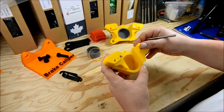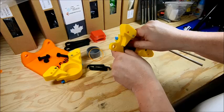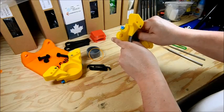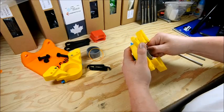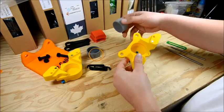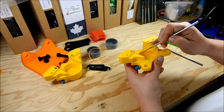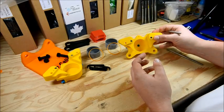And for that body, same with this side. Two fingers over here, two thumbs in the piston, slide it out. This one comes out a little sideways — pop it out. Same piston on this side, they're identical basically. Get in here again and pop this ring out as well.